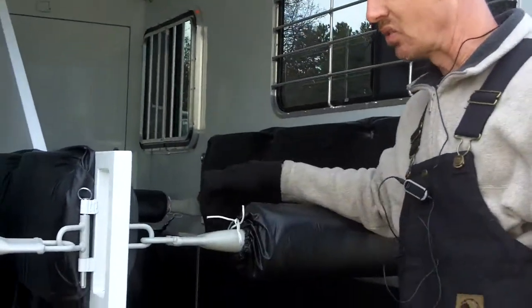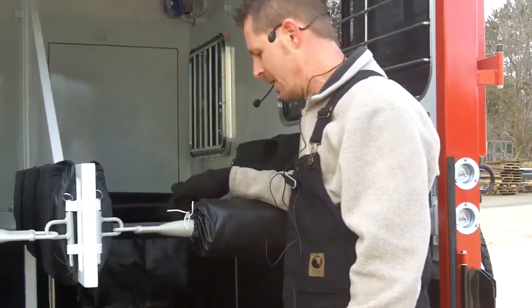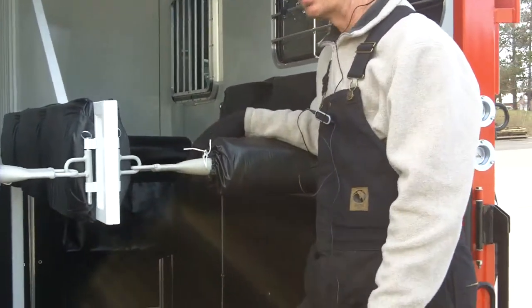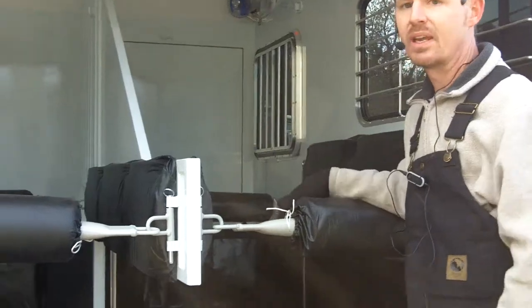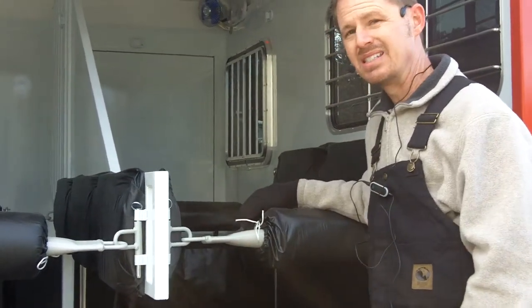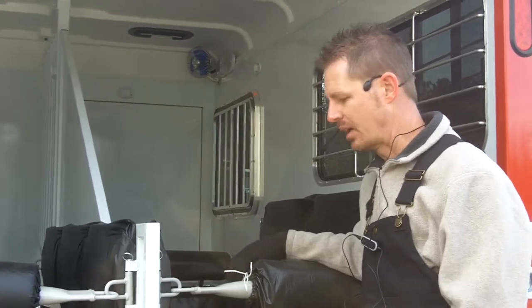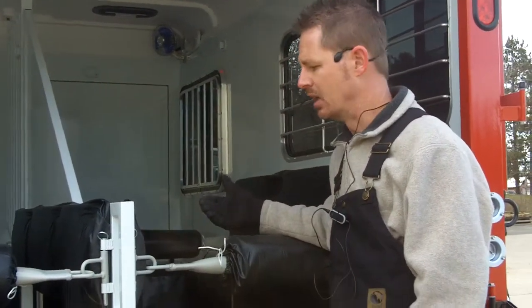We did elect to add on this trailer a rumber flooring — that's R-U-M-B-E-R, like lumber with an R. I really like rumber. The advantages are it's very quiet. It transfers probably the least amount of heat, noise, and vibration in comparison to a wood floor, and certainly much less heat, noise, and vibration when looking at an aluminum floor. We never recommend an aluminum floor because the urine is very acidic and can react negatively with aluminum. Certainly if you keep it cleaned that's not going to be an issue, but you have to pull the heavy stall mats out.